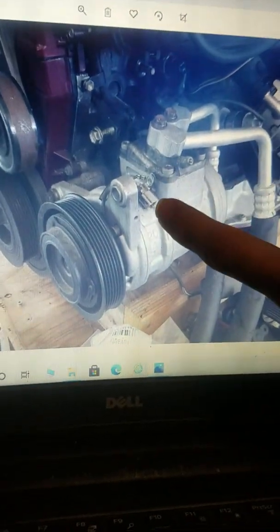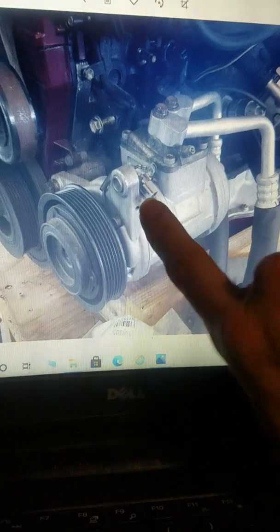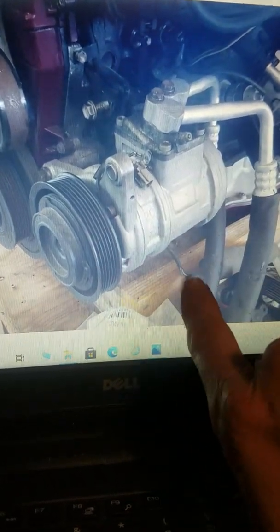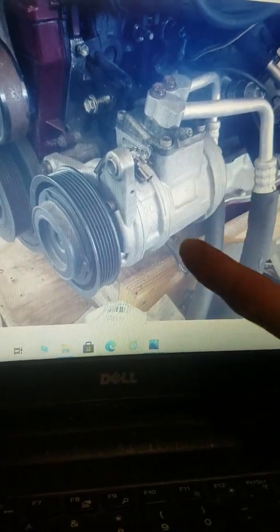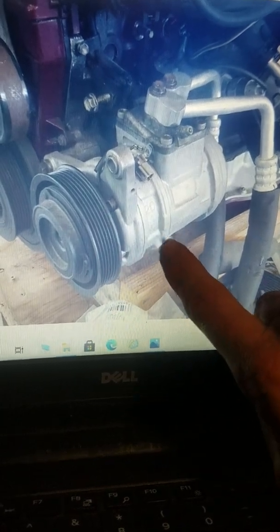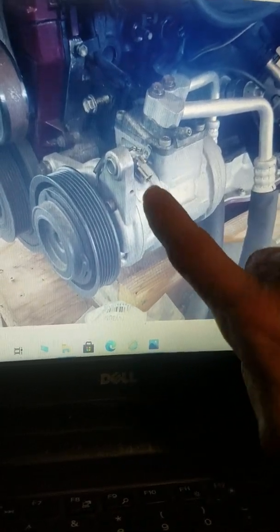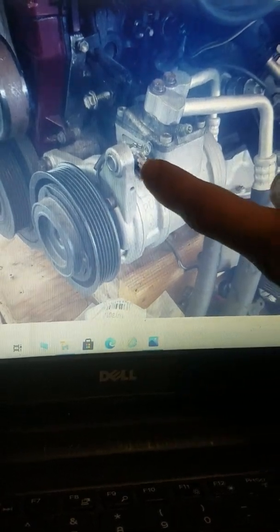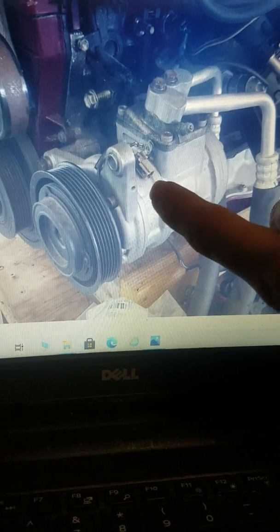So here's another picture. I want to point out the JZ compressor comes with a harness that is plugged into another harness. There's some kind of 4-plug thing that goes down to, I think, a speed sensor switch. If it detects that it locks up, then it locks out the compressor. But your 7M harness is going to have this plug sticking out very near the battery.